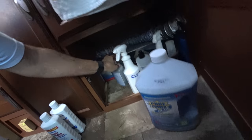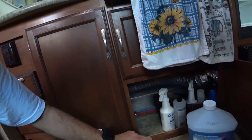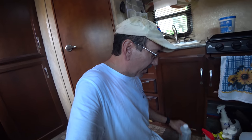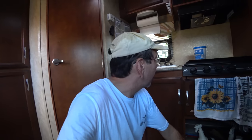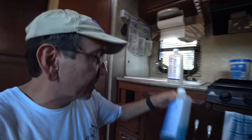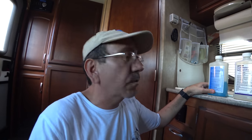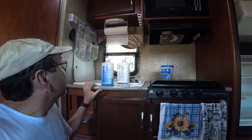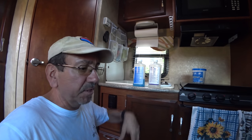This is the blue stuff I have here — this is the cleaning solution, and there should be another one... here we go. I have a big mess with all these fluids. But I've got this — this is the fresh water tank sanitizer and the cleaning solution. I think the cleaning goes first and then you do the sanitizer, so I'm going to do that now. You have to fill up and empty the tank like three times, so this is going to take a while.